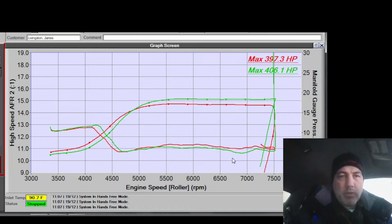Alright, so 20% wasn't enough, as you saw there. Didn't quite get there. I'm glad about that, honestly. I'm happy that it wasn't enough, because I don't like having such low resolution. I like having high resolution. I want to need to use a lot of wastegate duty cycle to hit my boost targets.